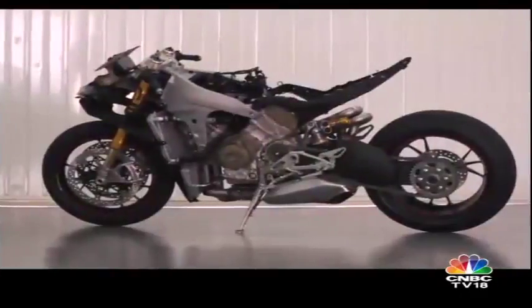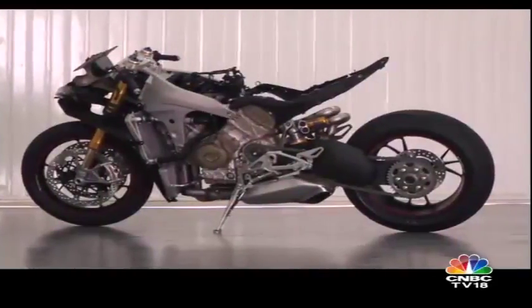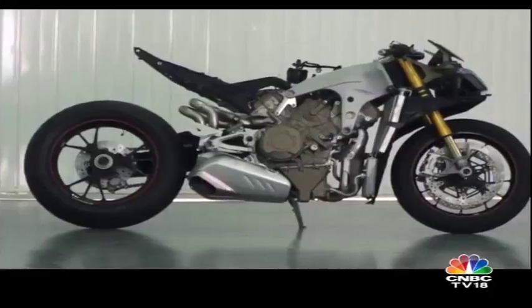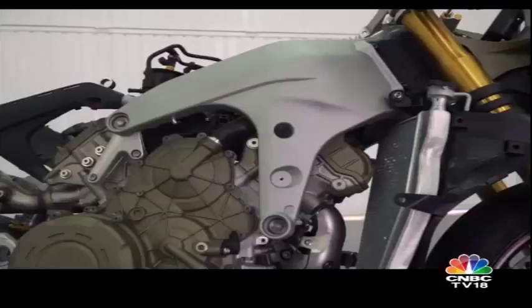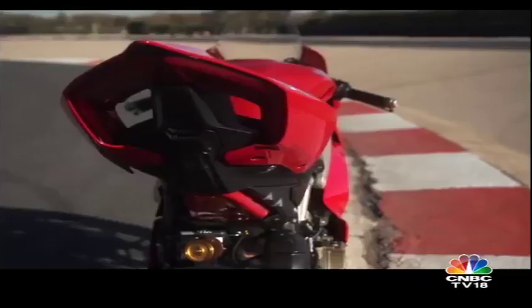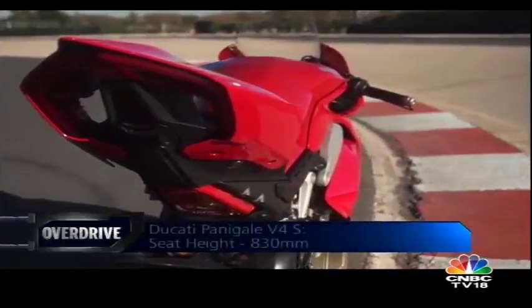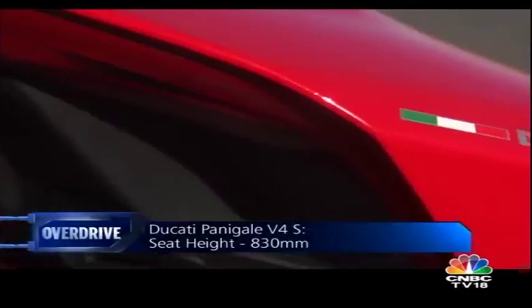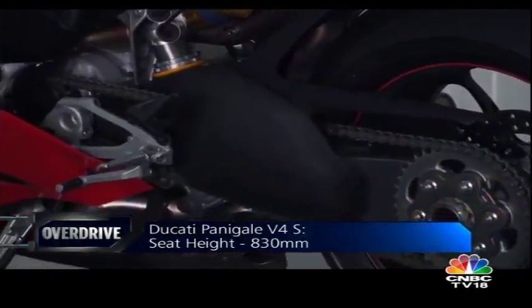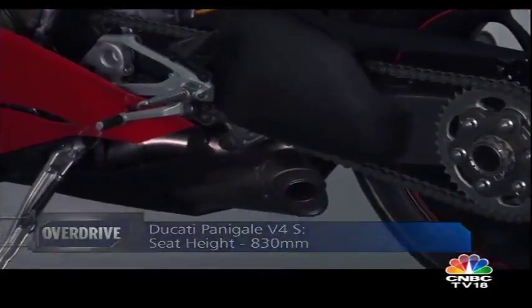The engine is used to make most of the frame as well. The monocoque is retired in favour of the aluminium front frame. Think of that as half a twin's perimeter frame, which bolts to the front of the crankcase and the front of the rear cylinder bank. The rear cylinder bank also provides the place to mount the subframe on which you sit, and the extra-long swingarm mounts to the back of the crankcases. That's a very spare chassis if you think about it.